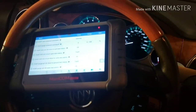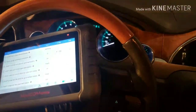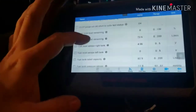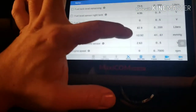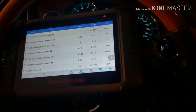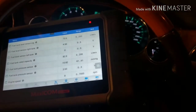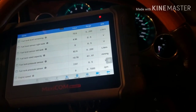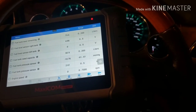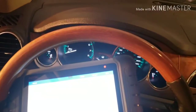In this case, when the vehicle is running, the vent valve is stuck open, and there's a vacuum. It's because the purge is venting the fumes out of the tank. There's a vacuum. That's why you saw the negative numbers here. Pressure sensor, negative numbers, because it's the vacuum. But it's not enough vacuum because the vent right by the tank is open. It's open because of that harness. The harness going to the floorboard, it's corroded, and I believe there's 6 wires in there, so I don't know exactly. I believe the level sensor is there too, so the engine light just stays on still because of that, because of the open wire.